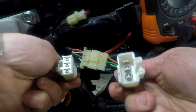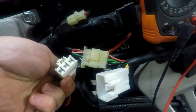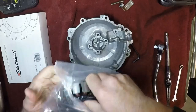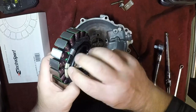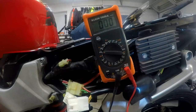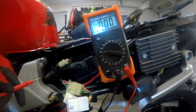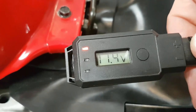To test this voltage, find the connector between the stator and your regulator rectifier. Open this connector up and focus on the stator side. If any of these three wire leads ground to the engine of your motorcycle, the internal structure of that phase in the stator has failed and your stator needs to be replaced. This is due to those insulated poles breaking down, and now all the electricity produced in those wire coils is going to ground. You can still have a functioning stator with a weak phase, however, and this is what live voltage testing will indicate. To test the live voltage on the stator, start the bike up. The bike will still run provided you have a charge in the battery, with the stator disconnected from the voltage regulator rectifier.